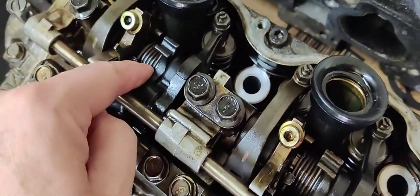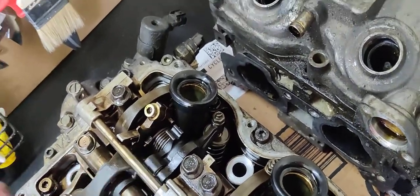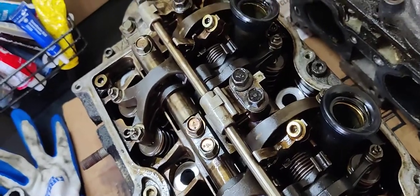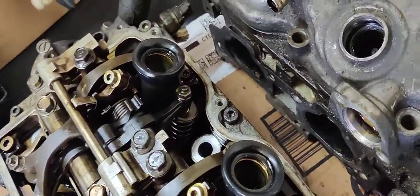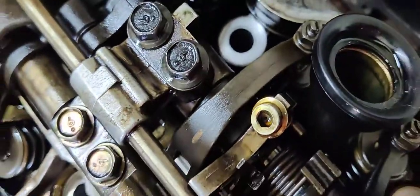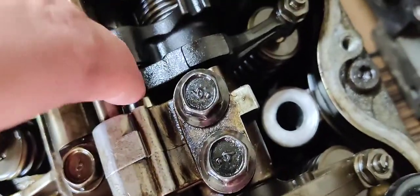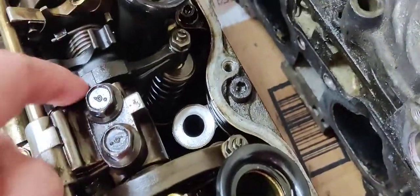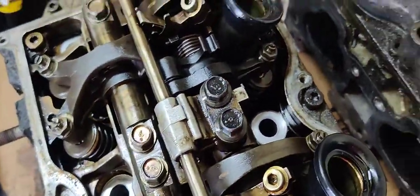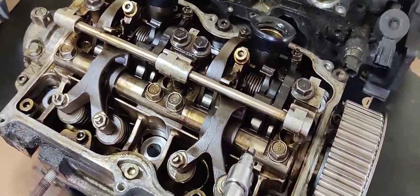So you've got this intake arm having a nice amount of lift and this one having hardly any lift at low RPMs — you get more combustion chamber swirl. With this system you've got this spring-loaded mechanism to keep this tertiary rocker arm in place so it's not flapping around. It's very similar to Honda's VTEC in concept, but the actuation is different. You've got these little push pins right in here that, when oil pressure signals to activate, shoot oil pressure through here, push one of these pins through, connecting the two together so this rocker arm follows the more aggressive cam profile.